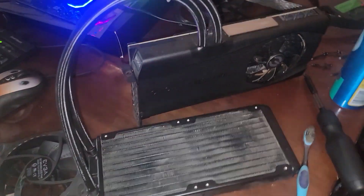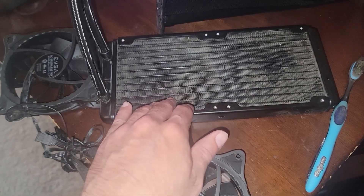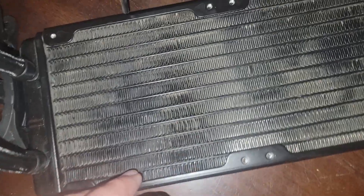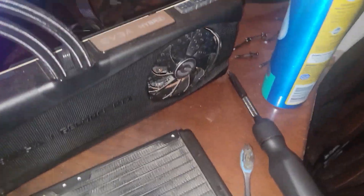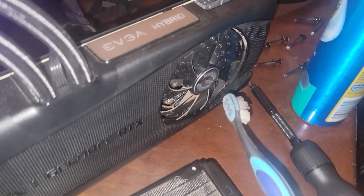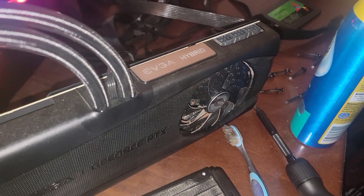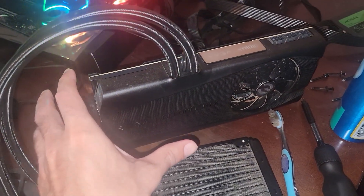This isn't going to be a complete teardown — I'm just focusing on getting everything cleaned up. The fans are good now. The radiator could be a little better; maybe I could run some rubbing alcohol through the actual fin stack to get the dust that's embedded between each fin. For the fan blades, the soft bristle brush won't get in there, so I'm using a Q-tip to very carefully get in there, loosen that up, and then blow it out as best I can.